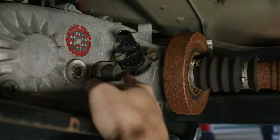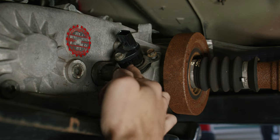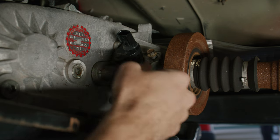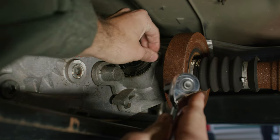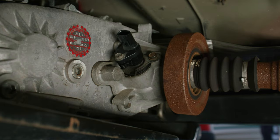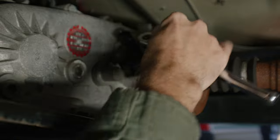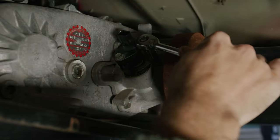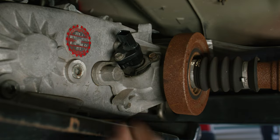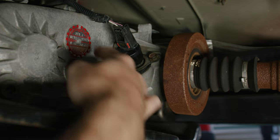You want to use the keeper to help you locate the position — it's not directly down, more like a five o'clock position, so the numbers are visible and in line with the lower part of the clamp bracket. It only works one way, so if you hop in your Jeep and the speedometer isn't working, you probably put it in wrong. Tighten the bolt — you don't need to go nuts with it, it doesn't need a lot of pressure — then push that clip back over and you're good to go.